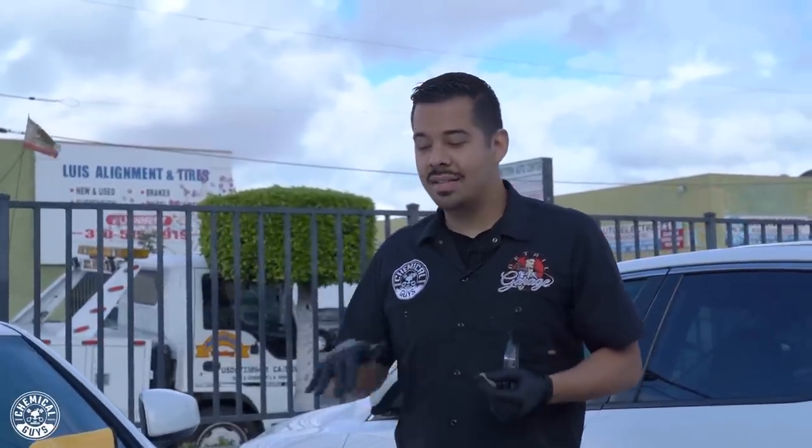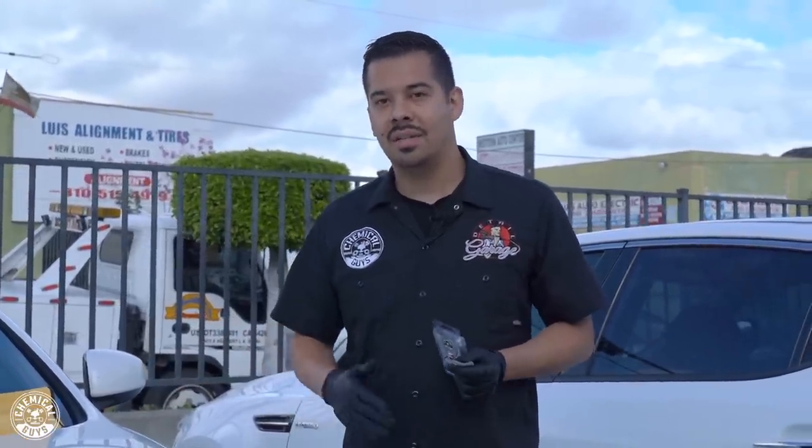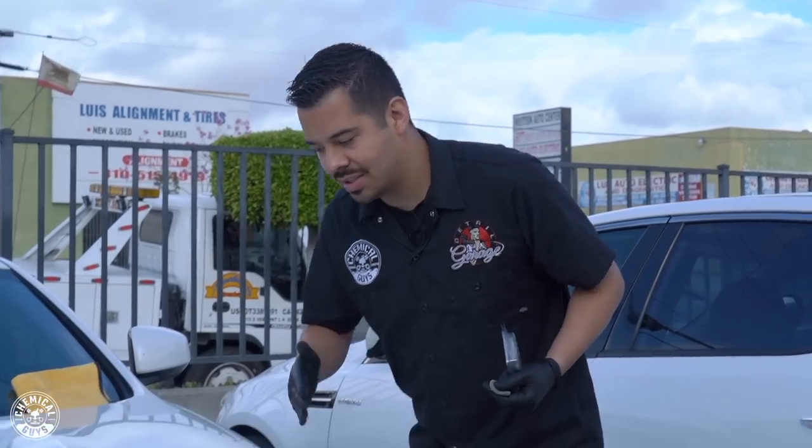For those heavier contamination levels, you can actually see it on these white cars. You'll see little yellow-brown specks on the paint, which on this white paint looks very nasty because you have all these tiny little specks that look brown, they look yellow. It kind of looks like you have a bunch of little bird poop stains on your hood, when in reality it's just industrial fallout that bonds to the paint and can't easily be washed off with a simple car wash. You actually have to use a medium grade clay bar to pull off that level of contamination. I mean, if you don't believe me, check this out. Just hear this.